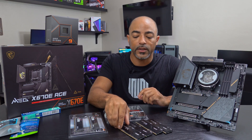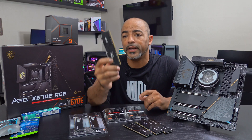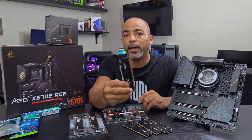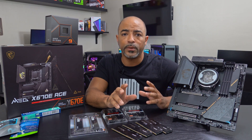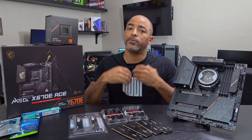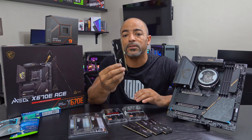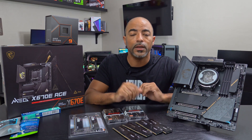What we're showing today is that DDR4 RAM — even though it's still new, still made, still relevant, still very fast — is no longer going to fit on these new motherboards. On the Intel side, you can still use DDR4 RAM on their brand new 12th gen and 13th gen processors because they're doing a hybrid approach where some motherboards say DDR4 compatible, some say DDR5 compatible. So you have to make sure you're getting the right motherboard on the Intel side. On the AMD side, it's just all DDR5. Somebody like me has tons of DDR4 sticks laying around, but I can't use that with the new 7950X processor because this new standard is only DDR5.